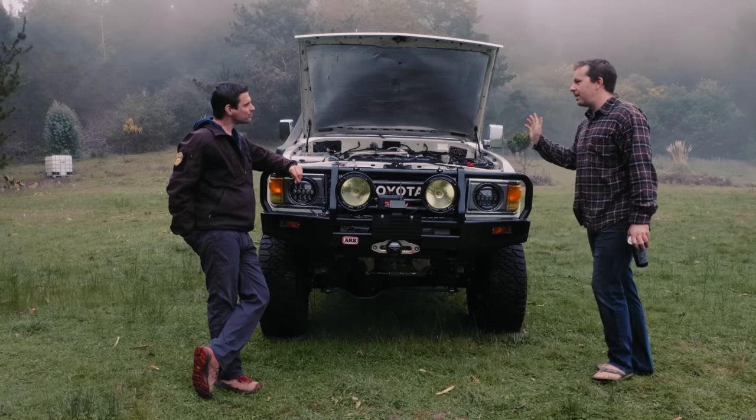Shocks are Fox 2.0 reservoirs with hydraulic bump stops. With a spring-over setup, if you don't move the shackles to the back it wanders. Move them back and you get dive, and steering gets harder with larger tires — so you chase issues down the road. Now this is a really good setup for a leaf spring-over axle. It tracks perfectly — no hands on the wheel at 80 mph. I have a PSC pump with hydro assist, and that alone fixed tons of issues.